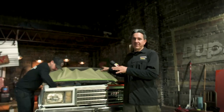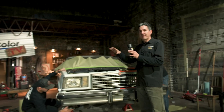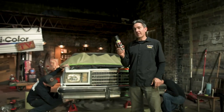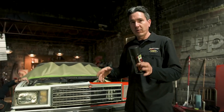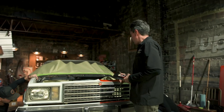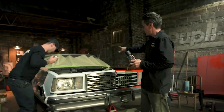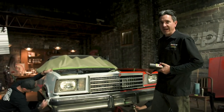Mark and Bill are attacking the frame and also going to do the firewall. We cleaned and degreased everything and prepped it for paint. There's a lot of bare metal on this frame, and one of the unique properties of the VHT roll bar and chassis paint is that primer is not needed — it's designed to bond directly to bare metal as well as a little bit of rust. We chose the satin black, which is offered in both gloss and satin. We feel the satin is really going to look nice across the entire engine bay and the frame itself.